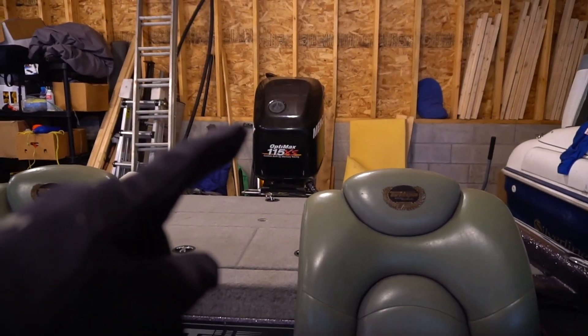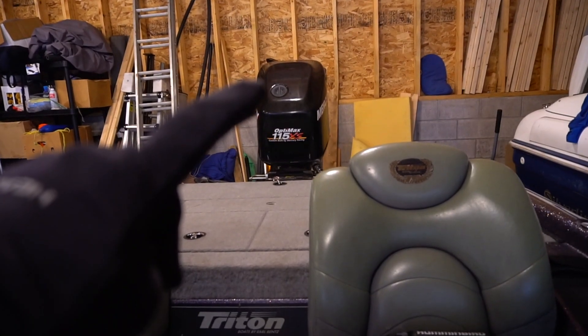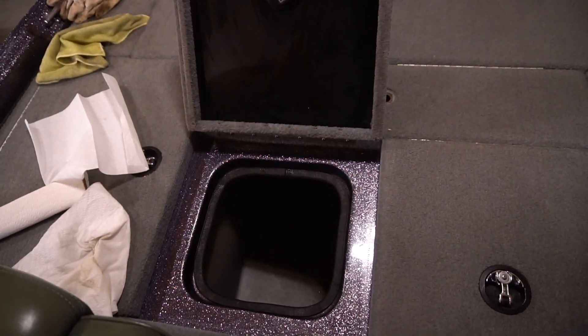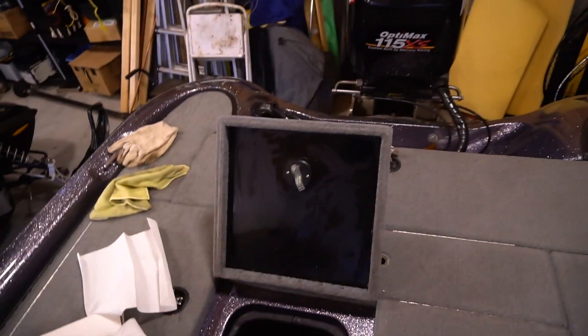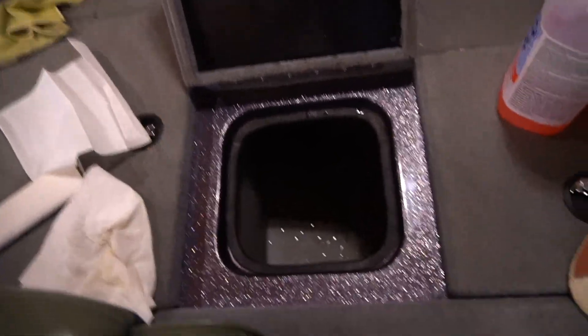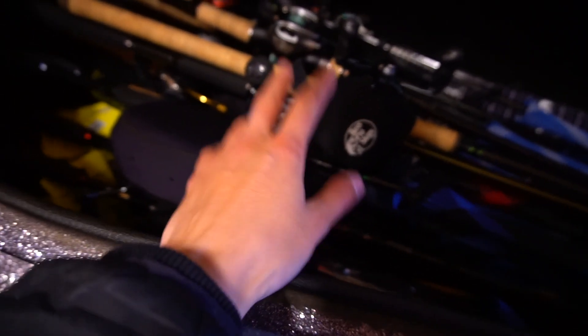I also have the seat conditioner I'm going to use to clean up the seats; there's also some sand in the corners. We just finished up the spark plugs and the gear oil. What we have left is the live well and batteries, and I think that's about it. We got as much of the water out of all the lines as we could. Now we're just going to stick a little bit of antifreeze in there, because there's probably going to be a little bit left and we don't want it to freeze and then when it melts, explode. So I'm going to do that and battery's out - I'm pretty much done. Now it should be fine.